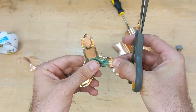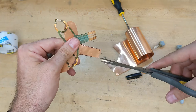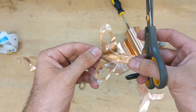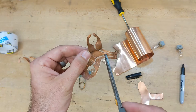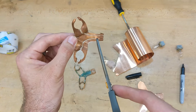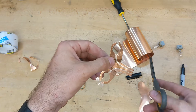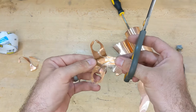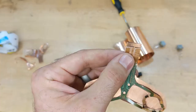This is super easy to do - not complicated at all, you just have to be patient. The first thing I'm going to do is trim this down so it's exactly right and then start cutting these leads up through the middle. See how it's got these copper leads - I'm going to cut this up and make three leads. The middle piece is the ground and the two side pieces don't touch. The whole thing is held together with masking tape - as long as the copper is bare at the contact points, don't put masking tape over the copper that needs to touch the light bulb contacts.